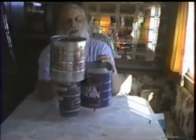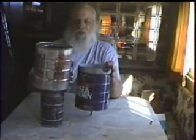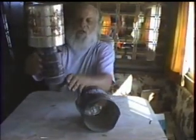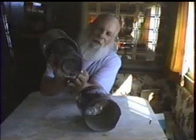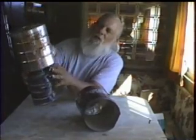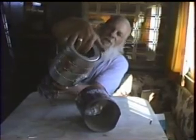In highway mode, the gasoline supply to the carburetor is diverted to this can here. The air goes around the outside of it, down through here, and up through the bottom. It goes through a heated coil hooked up to your exhaust manifold, goes up to the stack, and the flap now controls your rich and lean.